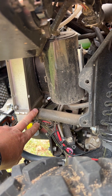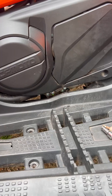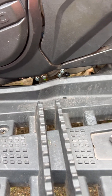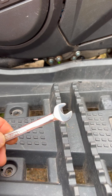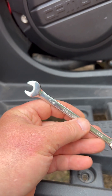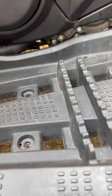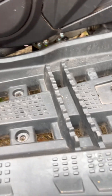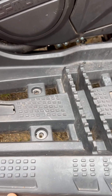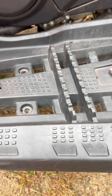That just fits right there, so you can see you can access your hose. I'm going to take a clamp, a crimp wrench, and pop it off. I cracked that nut loose — you can kind of see it is dripping right now. I used a 5/16 wrench, which will work on the 8mm too if you can't get an 8mm in there. I just pulled out these 4 bolts so you can kind of pull it out a little bit. They just go right in — you don't really remove anything.